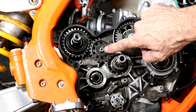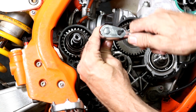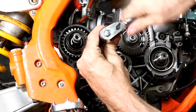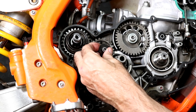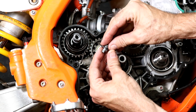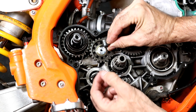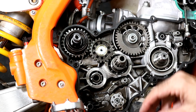The idler gear is held on with an M6 bolt and it simply unbolts. It's not particularly high torque so it's relatively easy to undo. It's been held in with blue Loctite, so when I put the new one in I'm going to use blue Loctite as well. You can see how short it is — the actual measurement is 12mm long, so a very short bolt.